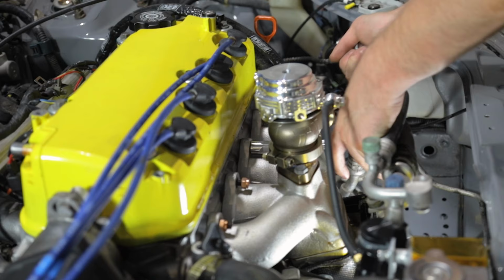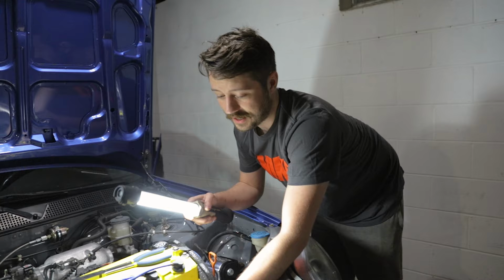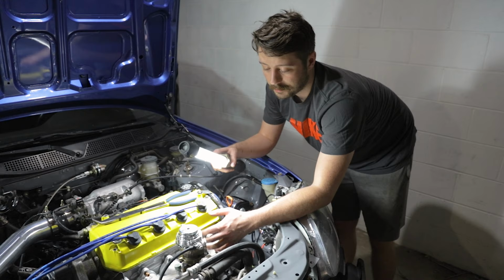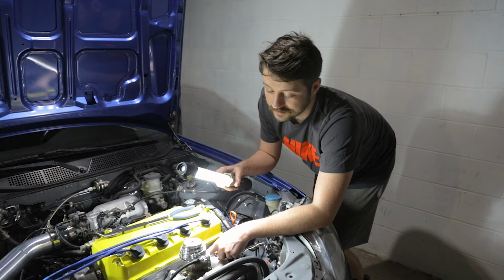I also got, also from Greg from Go Auto Works, his Inconel metal studs along with his copper lock washers. Obviously, everything's not tightened yet just because it's for fitting purposes, but basically this will help with a lot of the turbo people, the experience, a lot of issues where their hardware actually loosens up. And I was fine. I mean, after 2 or 3 drives, I was ripping on it, I will say, but I would have to come in here and do quarter or half turns to tighten everything back up, and that's just a pain in the ass.